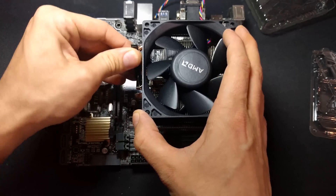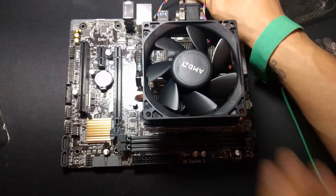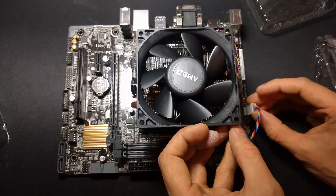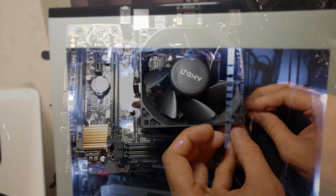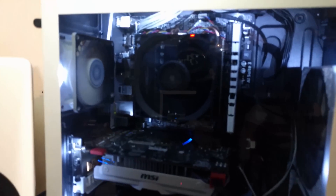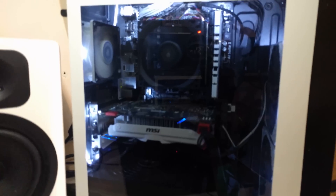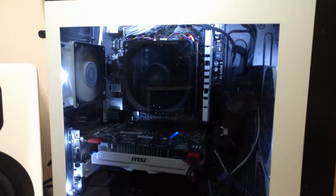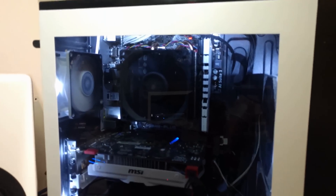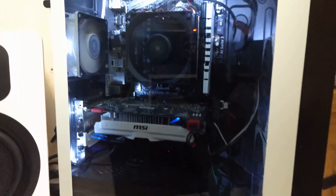Lock it down - push it back that way and there you go, it is in place. You can then finish off by installing your fan cable, which I'm probably going to cable tie up. Here it is all in my custom painted case - I cut this window out myself. It does look nice in there. If you put a nice colored fan on it you'd be really happy with it. Currently temperature-wise I'm getting about 38°C idle through my motherboard software. I'll put a real temp reading in the description. I'm also updating my BIOS, so we'll see if that makes a change - but overall I'm really happy with it.